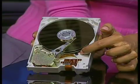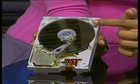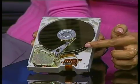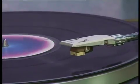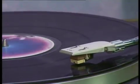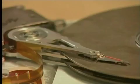The larger the storage capacity of the drive, the more platters there are. Each platter is magnetized on both sides. So a drive with two platters has four sides to store data. When a hard drive is turned on, the platters spin around like a record. Then special heads access data off the spinning disk and make it available for use.